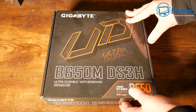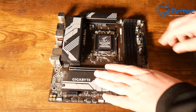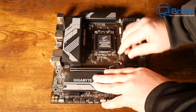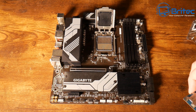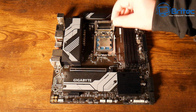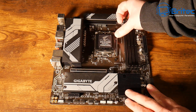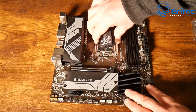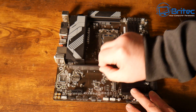This is probably one of the best boards you can buy at this price point for DDR5 RAM — if you're looking for a decent Micro ATX motherboard, something like this is right up your street. Let's pull the cover down, put the CPU in, and push the retention lever back. Keep that cover safe. Next we're going to deal with the M.2, so we'll remove this heatsink cover.